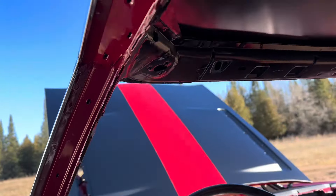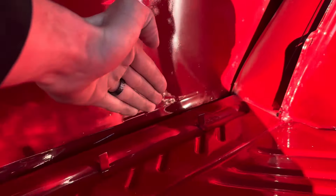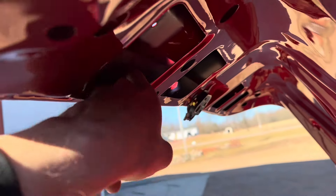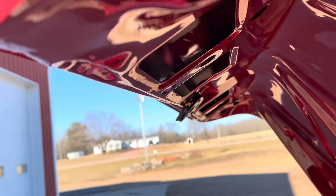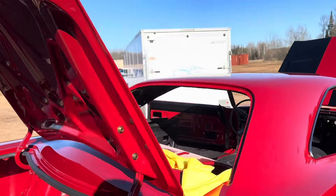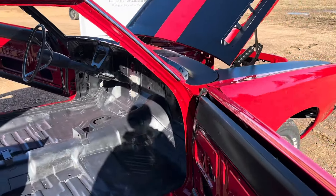Same on this side — inside the doors, inside the rockers, inside the cowl area, inside the windshield post from the top through that hole right there. Back here in the quarters, inside the rockers, down in the quarters, up over the wheel arches. In the trunk, we do up in the wheel arch, all the way down in here where you really can't see — both sides, the inside of the trunk lid, and right along the seam, especially since we did rust repair along the back. We want to lock out any future rust on areas we couldn't get to with epoxy and blasting.